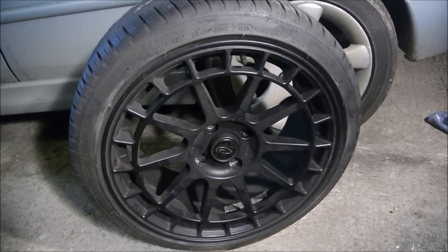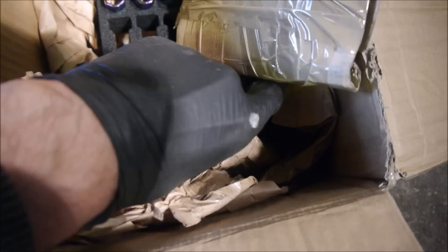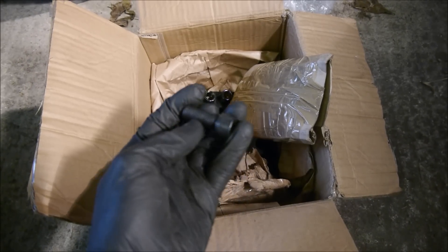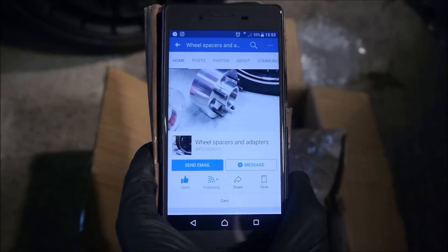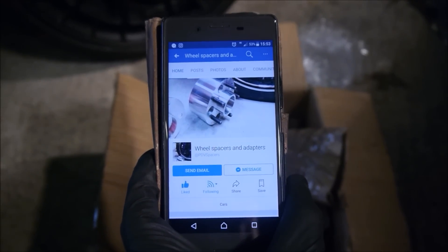These are Michelin PS3 tyres on the wheels, which is another reason I got them. The spacers also come with sockets that don't damage the chrome. You can also get the spacers with the bolts to fit them — they send you the right size bolt for your hub. These are 12.9 tensile bolts, and they fit nice and snug inside the spacers. That's PDV Spacers — I'll put a link below. They supply on eBay but you can go direct, and they'll give you a discount if you mention Piggy Power.